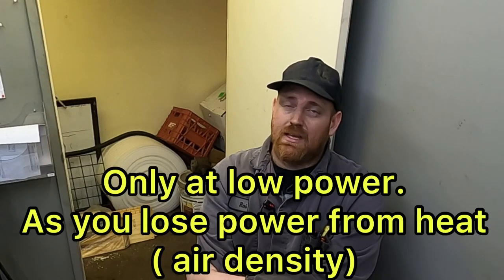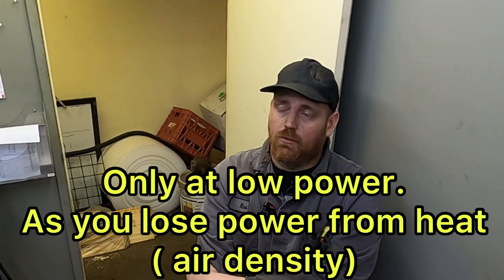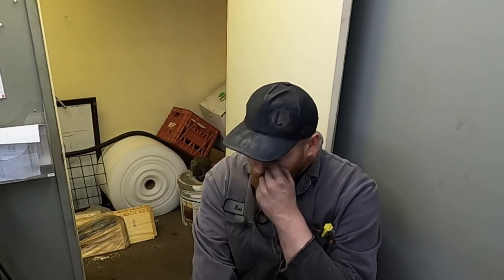The non-intercooled trucks actually make a little more power than the intercooled trucks. The reason for that is they have a bigger nozzle, so they put in more fuel. There are some differences with the injection pump — I don't physically have the flow numbers but I'll look into it. Your injection lines are different on a non-intercooled versus intercooled, the pump has longer delivery valve holders, and the injectors are nine mil on non-intercooled versus seven mil on intercooled.